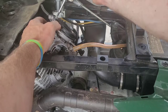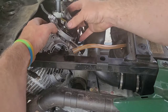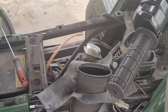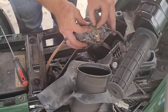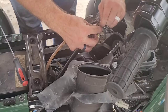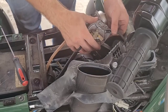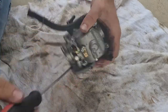This is a pretty cool design — there's just one screw that holds this in. This is for the throttle cable; you just unscrew it. Just be very careful you don't drop it, and you will get to the throttle assembly on the carburetor. This thing just goes up and down. You'll see there's a ton of grease on here just to keep everything nice and lubricated. If you hold the throttle open, you'll be able to just unhook the throttle cable. Then the adjuster on top, you can just loosen it up and the whole cable comes off. Nothing was very tight, so I had some pliers and unscrewed it. Boom — out. Now you can just take it over to the workbench and rip this carburetor apart, check out the jets and see how bad they are.